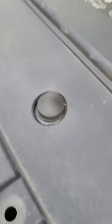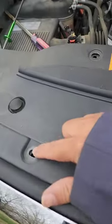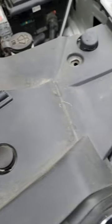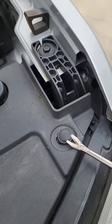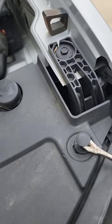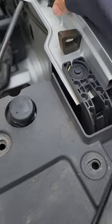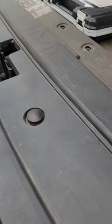Something's wrong with the actual little motor inside the shutters. I'll show you how to get them off first. You want to get to the front of your vehicle and pop all these little grommets — I've already popped them out from the front of the engine compartment. They're all over the place. This is what they look like: little grommets that go in the hole and push down — that's what holds it. Use a little screwdriver to pop this part up and the whole thing comes up. There are twelve of them on there.